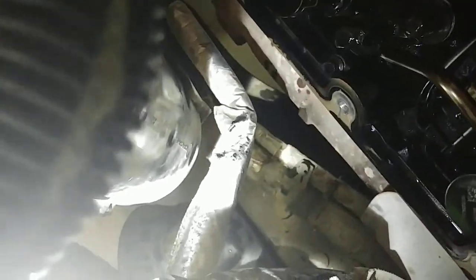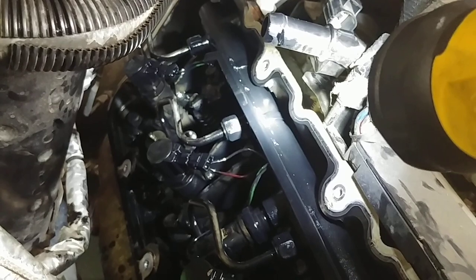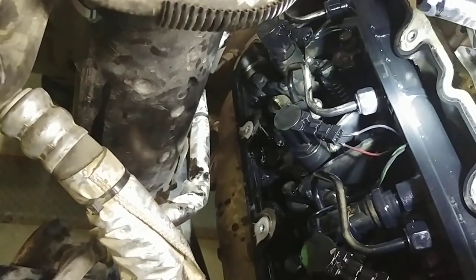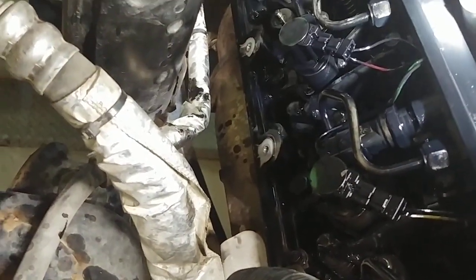Let's look at the tip. It's like 10 o'clock on Friday night. At least we tore it down. Rockers are screwed up — both of them are off, intake and exhaust. Both push rods are off. Let's see how much metal's in here. The bottom of the rocker broke — the ball pocket that the ball bearing rides on was broke off. You can see right there — the bottom of it broke off right there. So who knows.